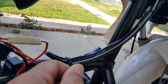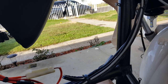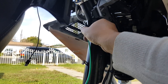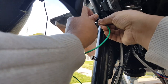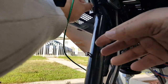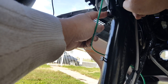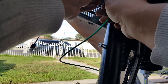I guess what we could do is actually mount this one first loosely, because we can't secure it tightly yet until we put the plastic frame on top — the plastic frame has a metal piece that goes behind as well to give a little more back support. We're going to find out our soldering end, so we could just go like this right here, or even come from the side. I think it's perfectly centered on that block. I chose green color because it's a good color for ground — your solid green colors on your wiring harness can run to any ground on the metal of the bike if you have it properly grounded.